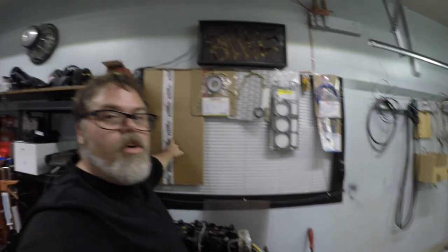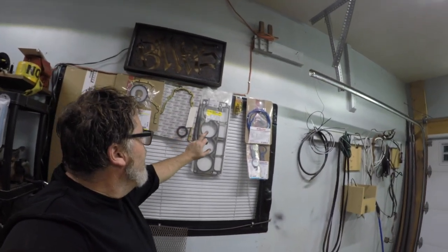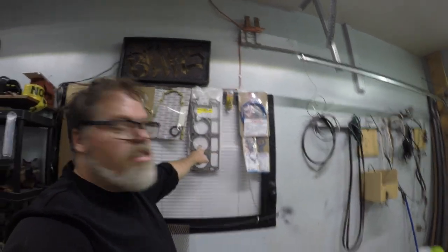The exhaust runners are nice now — smooth as can be. Hopefully you enjoyed this video of taking the springs off, the exhaust porting, and lapping the valves. That's my Friday night — how exciting! Don't forget to subscribe, like, and hit the notification bell. I got some gaskets in today — oil pan gasket, rear main seal, front seal, and valve cover gaskets. The head gasket I won't be using — it's too thick.